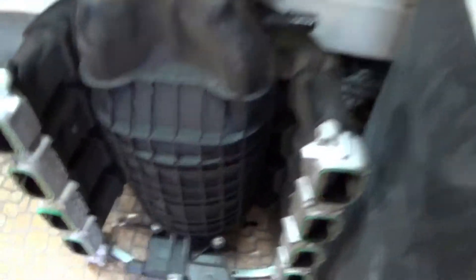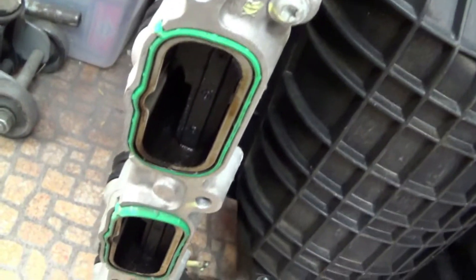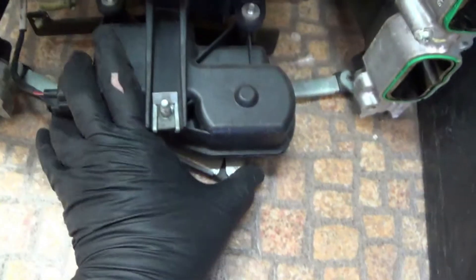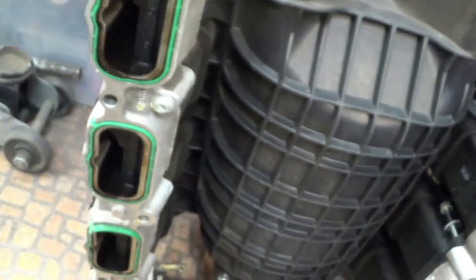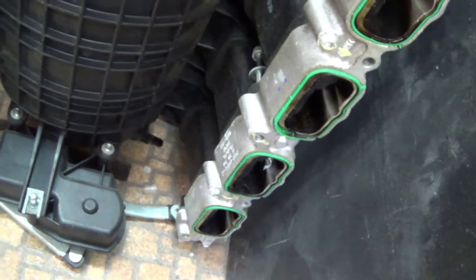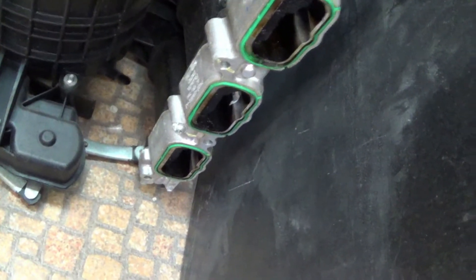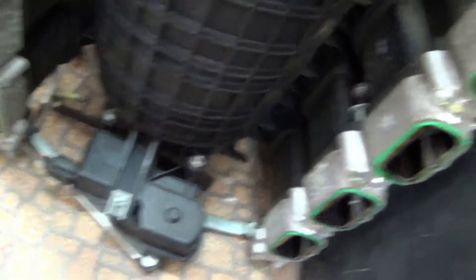You can see the manifold is off, and here is the existing manifold and the charge motion plates so you get an idea of what they do - they move via this contraption at the bottom. This could be a little black because I've been running the cams without a tune - that could be part of it. One thing to look for when you take this off: I see all of my gaskets are here - I would hate for you to lose a gasket down into an intake. Double check everything when you take it off.